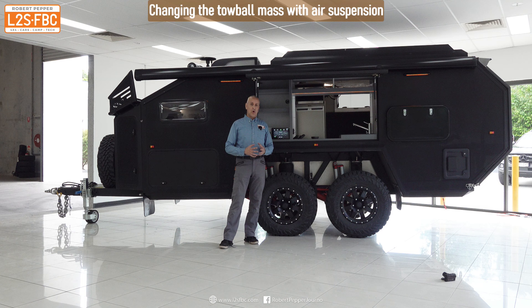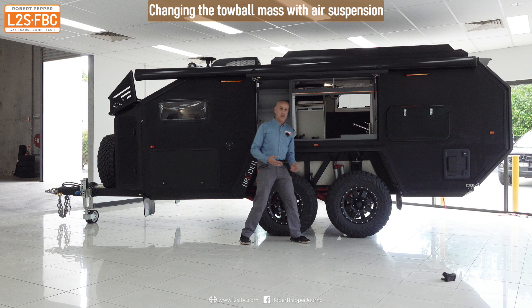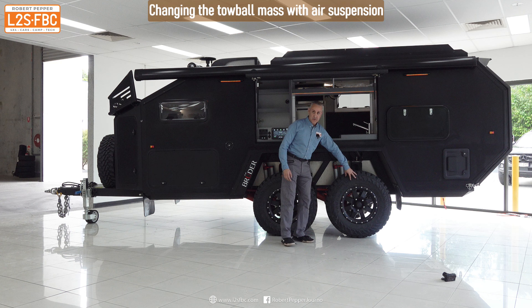If you're off-road that can be a real bonus. If you need to pivot the vehicle around on two wheels, you've pretty much got the rear wheels more or less in the air, not creating much drag. In an off-road situation you could pivot around the front wheels easily, whereas without that capability a 180-degree turn with the rear wheels dragging would be very difficult.